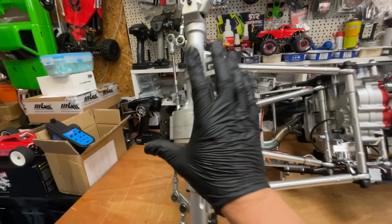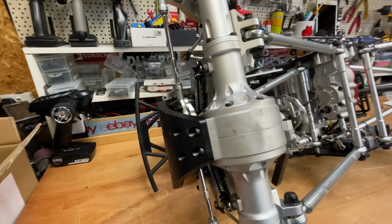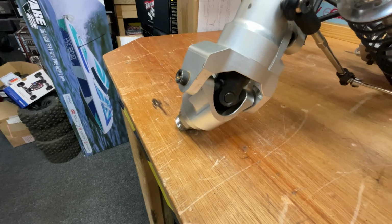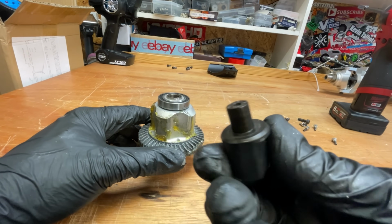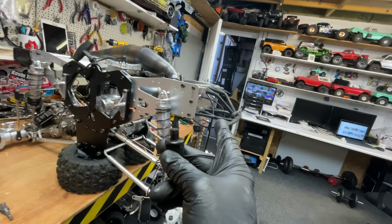So next, let's split open the front axle housing and see what's happened to the differential. We've lost drive completely. It's just rear-wheel drive now. Look, that's spinning round and that isn't. So there we go. That's what's broken. That's a common thing to go wrong on these Raminators.